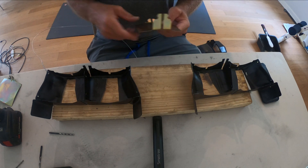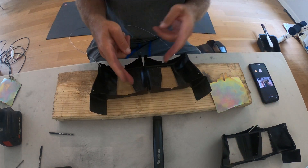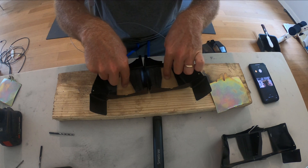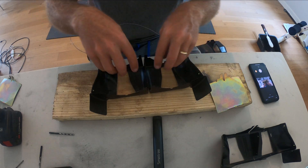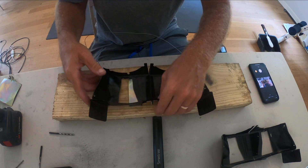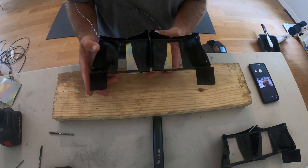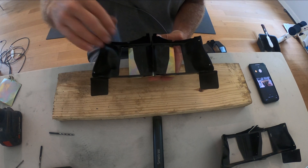I was just looking at them to see what the difference was. These I've modified - they used to have both these things curved up, and on the outside I cut off some metal which also curved up, so these two holes were basically blocked. The air would come down, swoop, and get blocked coming back up, which seemed like it could be restrictive. Then I took the deflector plate and put it on there.